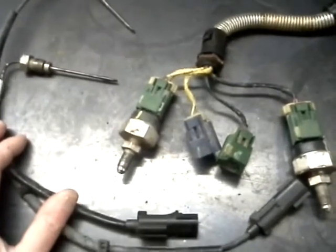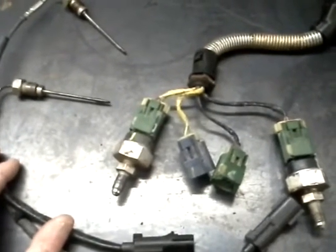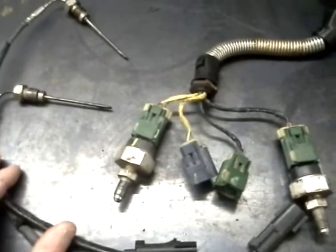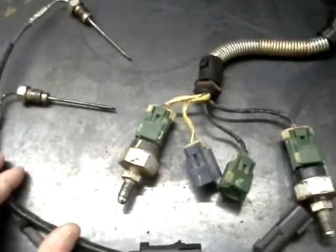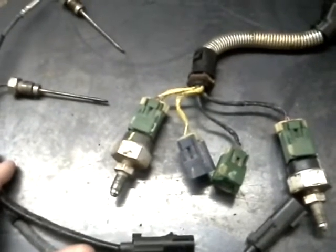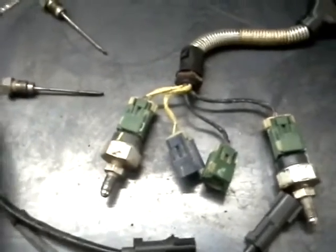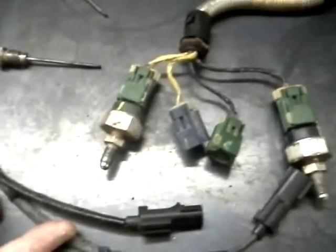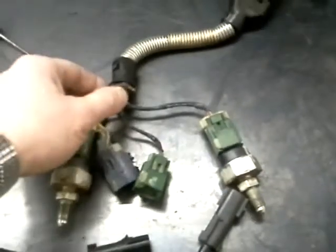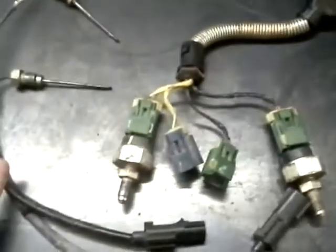The best thing to do is replace the sensors as a package, mainly for the hot exhaust code that you'll get in time with these particular diesel engines. This has absolutely made a world of difference. You can do one at a time, but it just isn't worth it by the time you get at everything. This is the harness inside a little case that's mounted on top of the DPF.